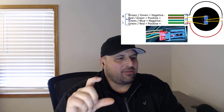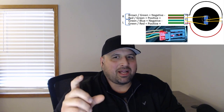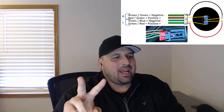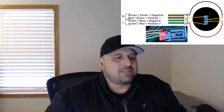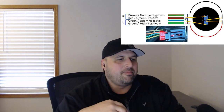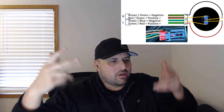I actually did the 9-volt battery test on a dual voice coil system, and I did the brown-green, the negative, and the green-red positive, because I knew those were negative and positive, and the voice coil wasn't moving at all. I was like, well, what the heck is going on here? Well, that's because I just wasn't really thinking about the dual voice coils, and that the coils are connected in a way that they can work in unison or separately.